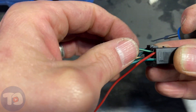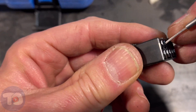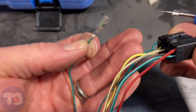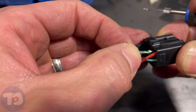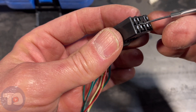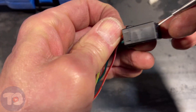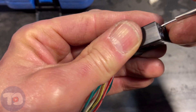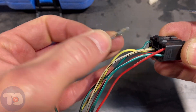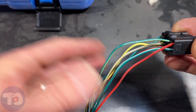Now let's go for this green wire here. Just insert the tool here under the terminal and feel for a lock. Give it a little bit of a pry and a push, and when it clicks, you're done. One more time — it goes in here under the terminal and you're just going to pry down on that locking tab. Then we'll replace it this way. That's it — pretty simple.